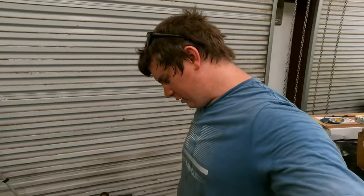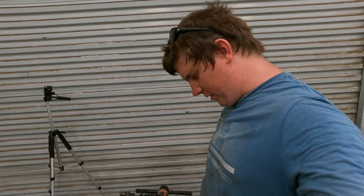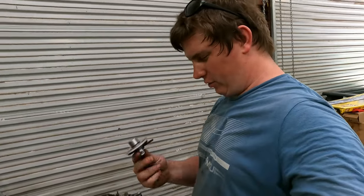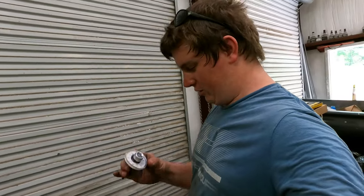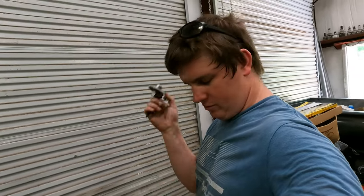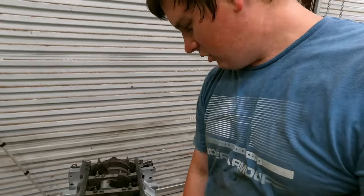All right, cranks in. Everybody's torqued at 15. And then retorque, and then re-angle torqued at roughly 80 and 50. I do have a torque angle gauge. It's a cheap one. I don't like using these things. I can't read them real well. As long as it's in a spot that I can, you know, 45, 50 degrees, 90 degrees-ish, I'm going to do it without it because vision. Simple. So cranks in, rolls good. There we are. Now let's put the rest of it together.